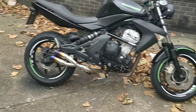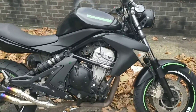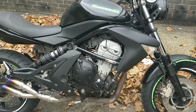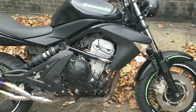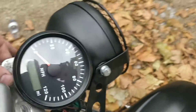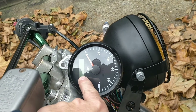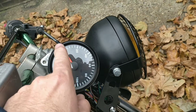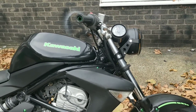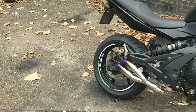This bike passed — it has a basic MOT. It's safe, it's road legal. But there are a couple of bits I want to re-look at. The speedo I need to bolt down properly — I've taken this old bolt out because it was rattly, so a good bolt, that's easy. The speedo's not recording mileage, it's going back to zero every time, so one of the spare wires must be a memory wire. It probably needs plugging into a power source that's constant. I'll check that out because I want it to read the new mileage from now on.